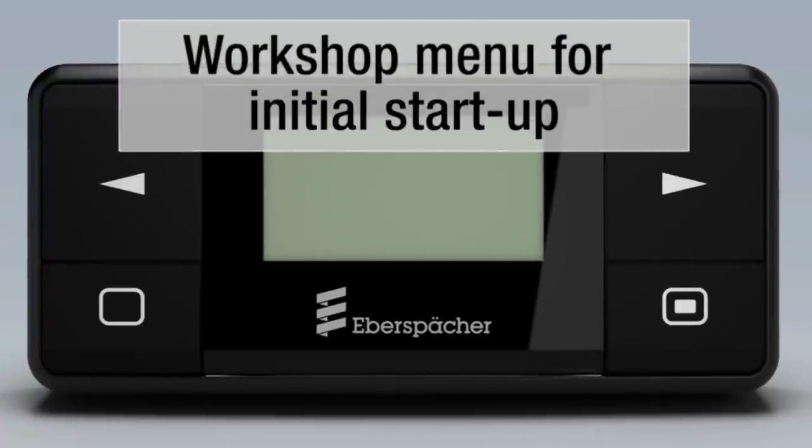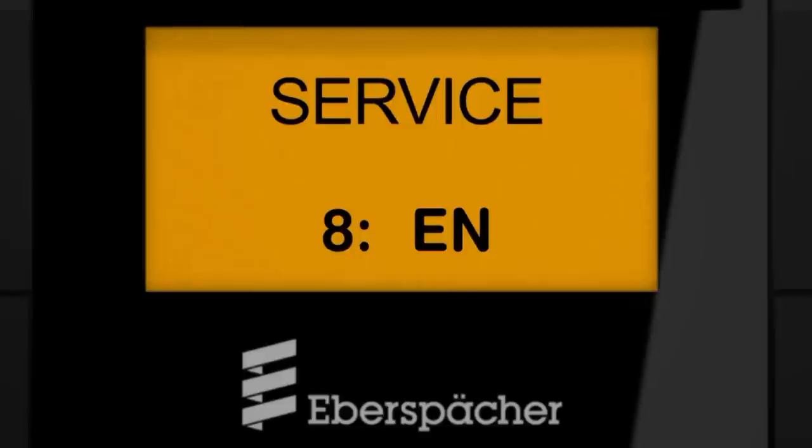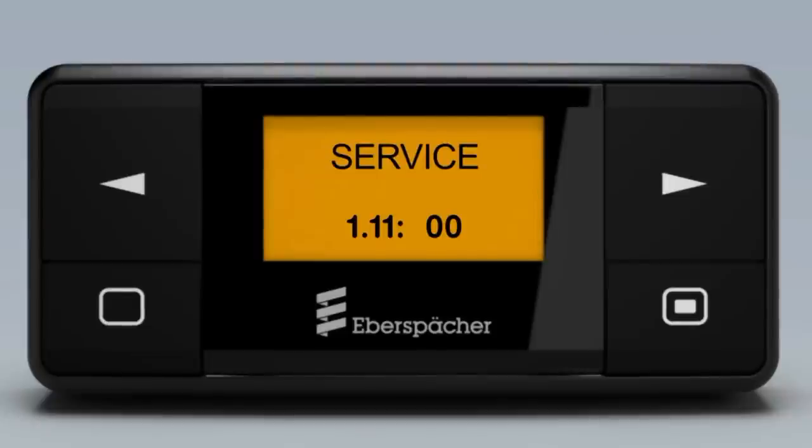Workshop and diagnostic menu. On initial startup, carry out all basic settings as per the customer's wishes: temperature units Celsius or Fahrenheit, limits on running time, language — English or German — and programming options. For example, for managing heating time when setting a departure time, you can set the running time to be calculated based on the outside temperature, or set fixed running times based on departure time. When initial startup is complete, you can check the function of all connected heaters using diagnostic mode.